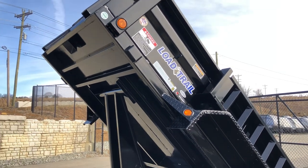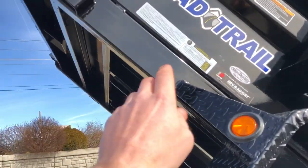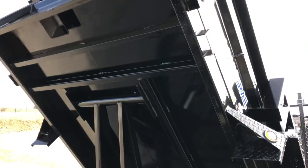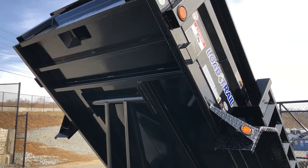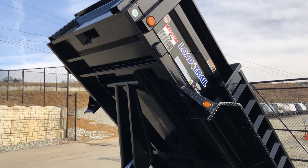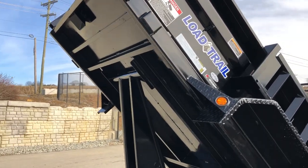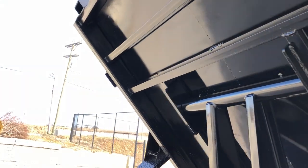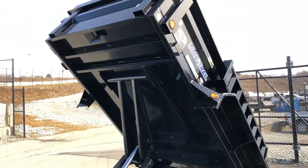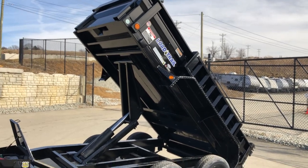A lot of five-wides don't have a bed frame — a lot of times the sidewall comes down past the floor and forms in, and the cross members would be held in place by that sidewall extension. That's certainly not the heaviest or best way to build a dump trailer, but it works for most lighter duty dumps. On this one they've taken a 4-inch tube bed frame and put all the 3-inch channel cross members into that 4-inch tube, so they terminate to an outer tube bed frame. That makes this a lot stronger and also gives you a nice frame for the scissor hoist to tie into.